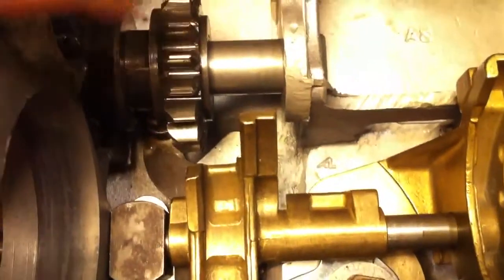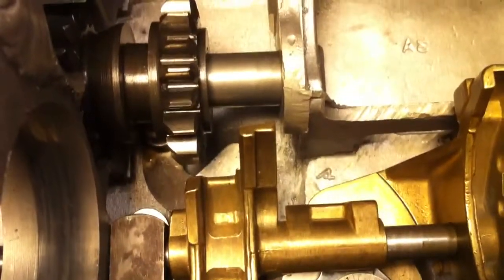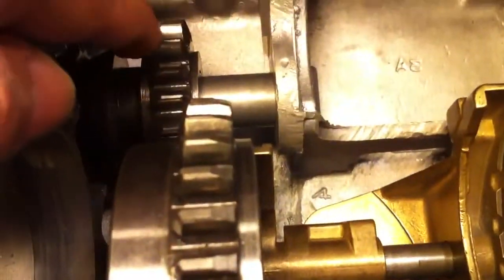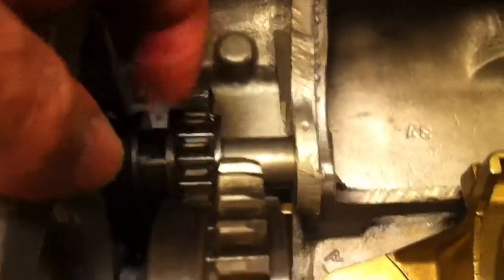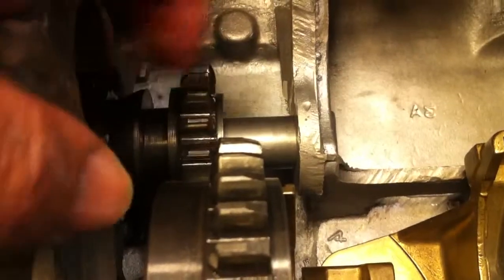There's 1st. And you can see even now, you've got a big outer tooth here. Let's drop it in place. It's this guy. So we can see that as far as this comes out in the gear position, we've got free play here, whereas before we could slop this over enough to hit that gear pretty hard.